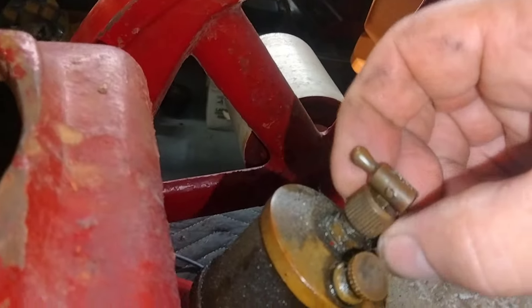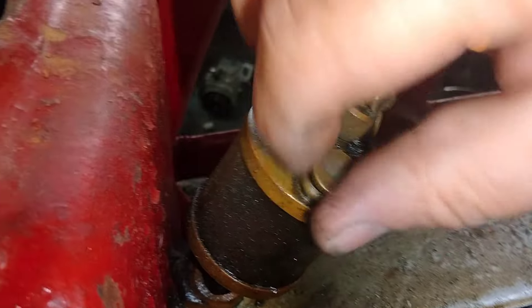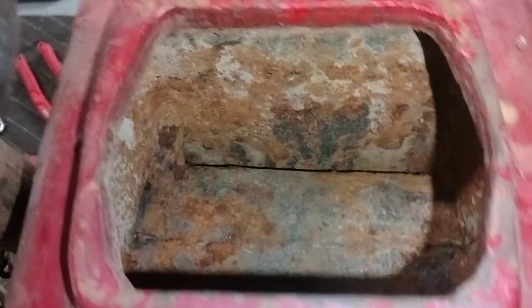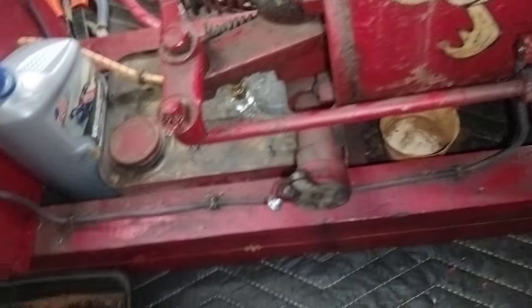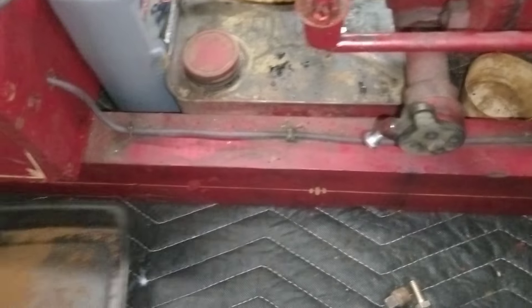Every time it's not firing — on the strokes where it doesn't fire — the buzz coil is off. For those wondering how a hit-and-miss motor works, this is a simple one. You have these fly weights here; centrifugal force pushes them out and this adjusts the RPM. You put more spring tension on it and it'll run higher. The weights pull this gear away, which pulls this arm and holds the exhaust valve open.